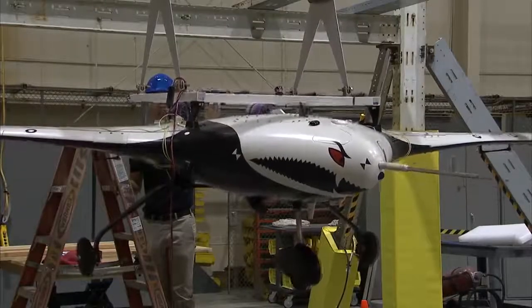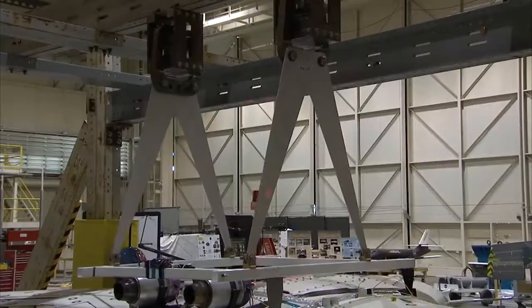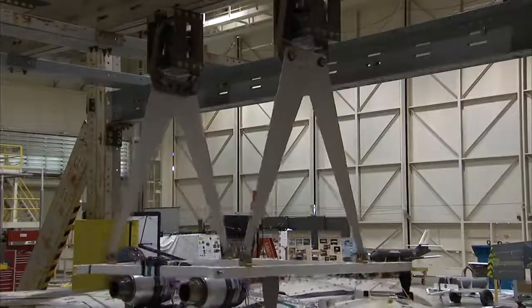We test in two different lengths — you can see those hanger plates which connect between the pivot and the vehicle. What this helps us do is allow us to obtain two independent sets of data. It's essentially two independent tests we can do for not a lot more work to get some good data to work with.